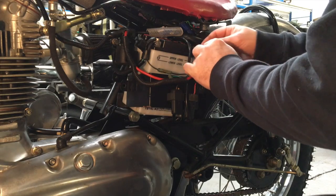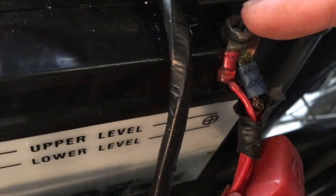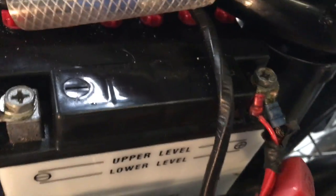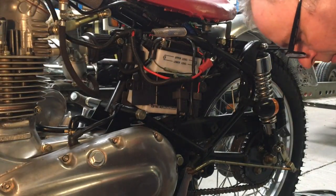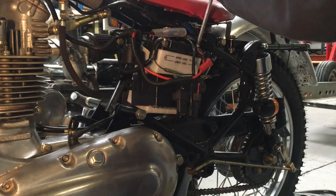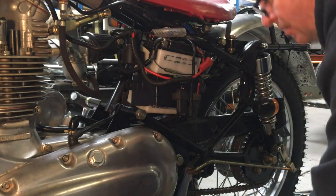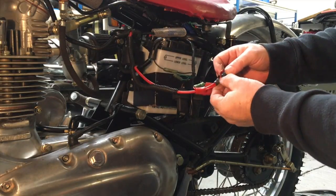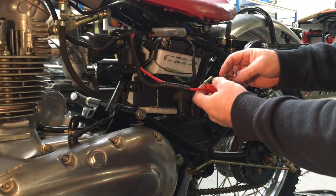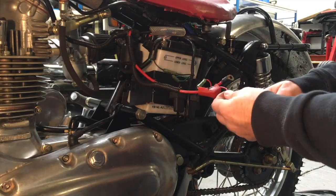Unfortunately, looking at this, I don't like the look of it. These are two crimped terminals which are looking a bit unreliable. What I'm going to do is take that off and solder on a better connection — make it nice and reliable. That's what I like: really reliable bikes. So let's take it off. Looks a bit dirty. I don't know why there's two wires in there. I'd be much happier if that was reconnected in a more professional fashion. First thing I'm going to do is cut these horrible connections off.